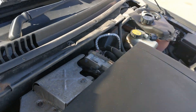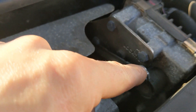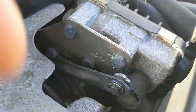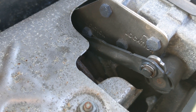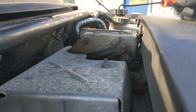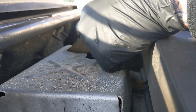So out here we've got the turbo on top of the engine, and this is the actuator arm and the actuator. We just need to pop this little circlip off and see how free that arm is. I'm going to get some gloves and some tools and we'll do that now. I've got a little pick and I'm just going to try and do this without dropping it, because that wouldn't be ideal.